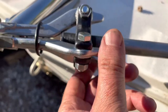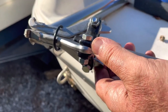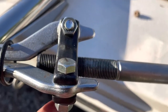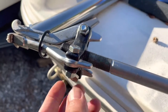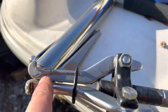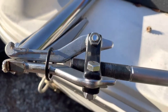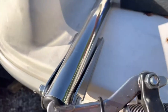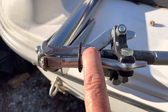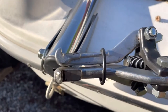Then you reach in there with your hand and grab hold of these fingers inside, and you twist the slide hammer — you've already got the slide hammer on there. As this steel bolt moves out, it expands these teeth out to the gimbal bearing. You'll get to a point where you can't tighten it anymore and it'll be really tight, and as it moves out it expands these levers and they grab the gimbal bearing. When I get it really tight I back it off just a tad loose, and then I'm ready to go. You just start hammering and it pulls it out — very simple.